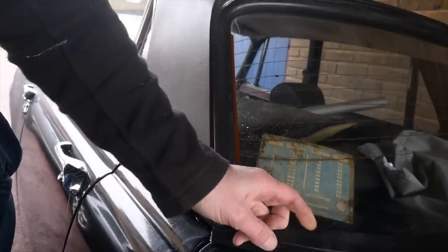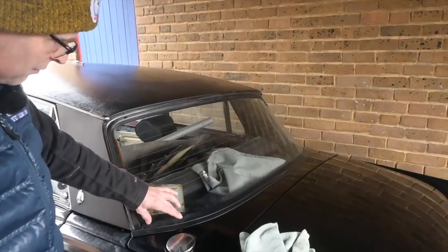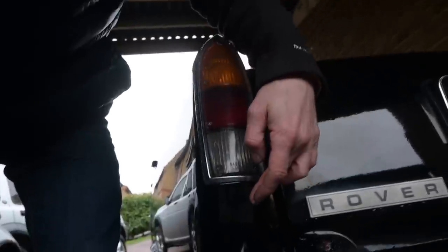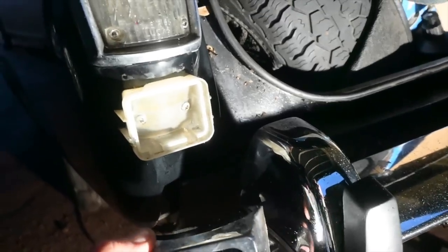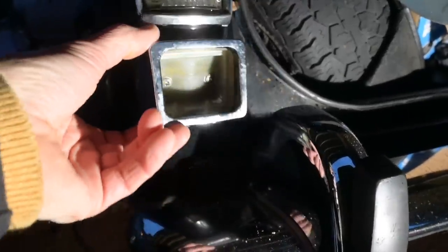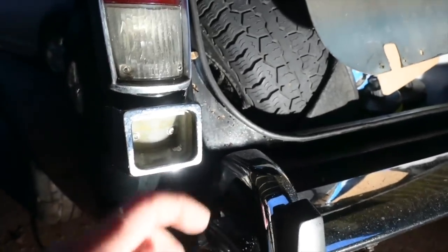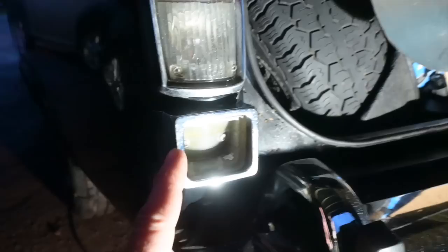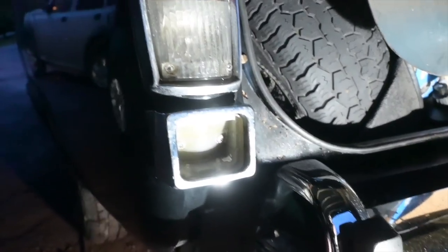This not-very-well-fitting window seal was shipped all the way from Australia because Scott's Old Auto Rubber was the only place anywhere that sold these things for a long time — and even then you have to cut it to fit. People were mentioning in the last video: do you know you're going to need reflectors for that car for the MOT? Yes, I am — they are currently in the boot. The guy who painted this car actually filled in the screw holes by mistake, so I had them glued on and they came off because gluing doesn't work. So this is how you mount up the reflectors to the back of a P6 — you screw a couple of holes into the back of the wing, then this slots over and a couple of screws go in the bottom. Rust-proof paint on the back of those screws so they're now rust-proofing into that. I hadn't put something on here previously because I didn't want to screw into my lovely new black paint, and I was thinking maybe there was a discreet place elsewhere I could hide a reflector that looks a bit non-standard and hot-roddy — but I didn't find a good alternative, so I've just done it.